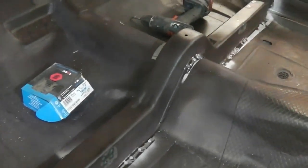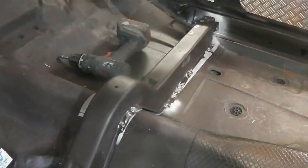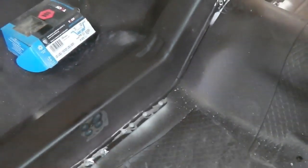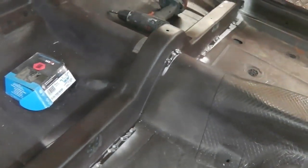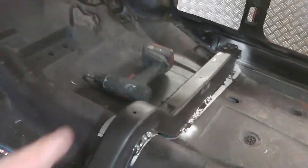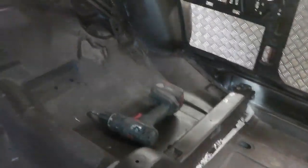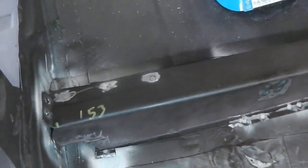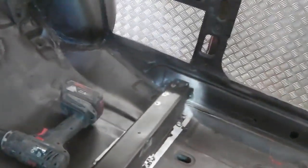Ladies and gentlemen, with the cross member prepared, painted and treated, and the reinforcing plates in position here for the seat, we are now getting the measurements correct so that it's laying square in the pan, because you can get some lateral twist. So I've measured from the corner of the parcel shelf tangs down to each corner, giving me 1.53, and 1.53 in that corner.